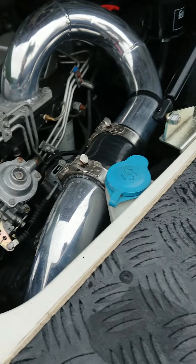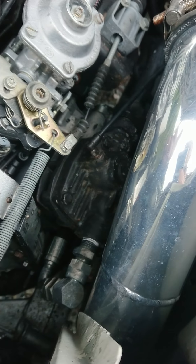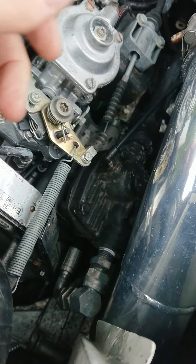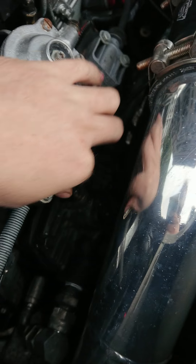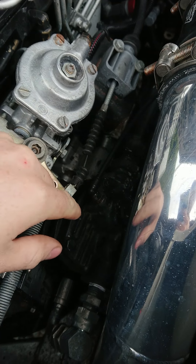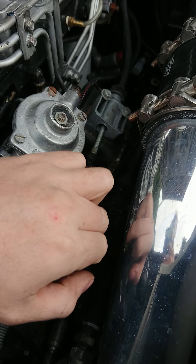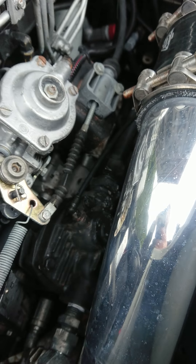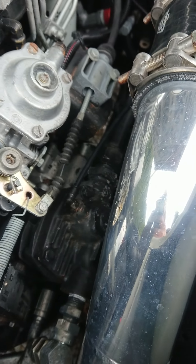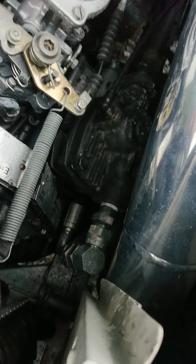I'm running the compressor — the Land Rover has air suspension, so I'm running the DAF 45 compressor. This is the regulator valve port. Basically whenever the D2 governor valve opens up, it sends pressure there, that pushes the intake valve down on the compressor, causing it to make no compression whatsoever — it just huffs. I'm running a double coupling and a hydraulic line. I've been running this for about 10,000 miles with no problems.